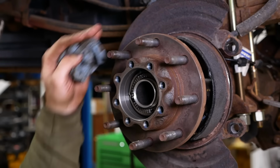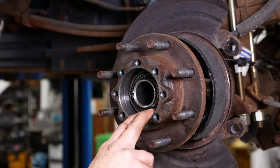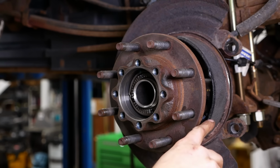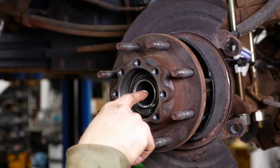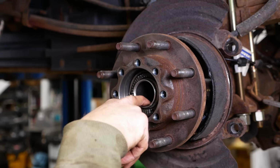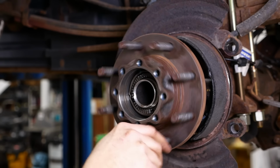So that's the setup. Anyway, back to the oil, or the grease, rather. On these modern floating axles, the bearings are lubricated by the same oil as the gears in the center section. So when the axle's in motion, the oil's gonna get splashed up and it's gonna travel through this axle tube and it will fill up the hub and keep it constantly full of oil.